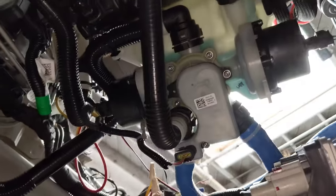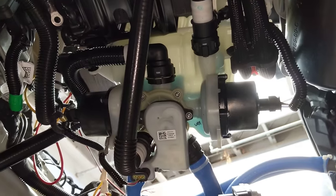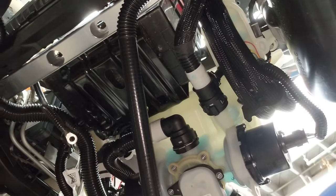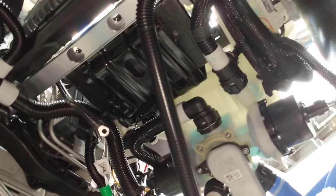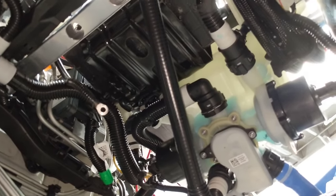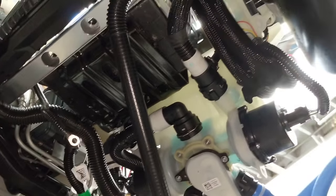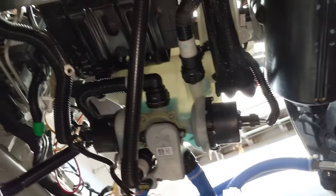It's pretty simple and very similar to the Model S, however it looks like it's overall just a little simpler, with fittings and stuff — they use a lot of pre-molded pipes. The noted absence is there is no battery heater. They use the powertrain waste heat, and they actually have a mode where they can put it in a less efficient mode to waste more heat that can heat the battery up faster in the winter. The waste heat from the PCS is also used.